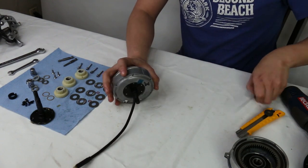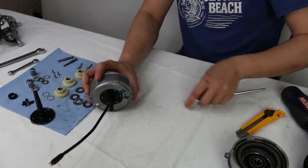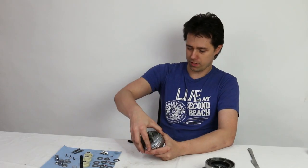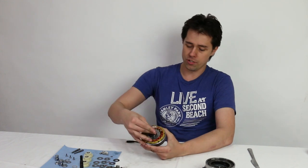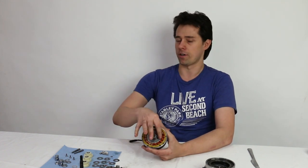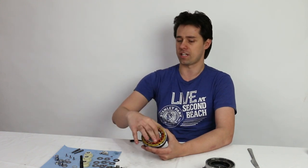We're going to use a butter knife to pry the two parts of the enclosure apart. With the planetary gears and thrust bearings removed, we can separate the cover plates and see the rotor and stator of the G310. This is a very different layout than every other e-bike motor — it is an in-running motor, meaning the part that turns and has the permanent magnets is on the inner diameter of the stator. Normally that's reversed, with magnets on the outside and copper coils inside.